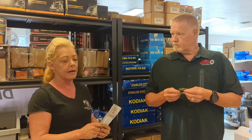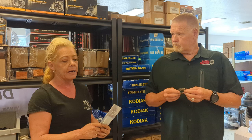We don't want you to ever have to use this or need it, but if you do, you certainly want it in your trailer. When we took our first run, we had no grease and packed it full of dirt. We're starting to think the Hub Saver was actually stopping the bearing from failing. In our testing, when we do have a bearing failure with the Hub Saver, the bearing lives a little bit longer because it's not allowing itself to beat itself up. Bottom line: we went 40 miles total — 20 without a bearing and 20 packed full of sand — more than enough to get off the interstate and somewhere safe to make a repair.